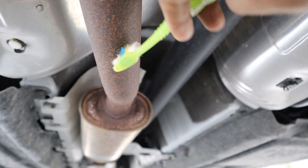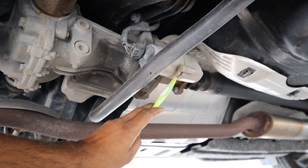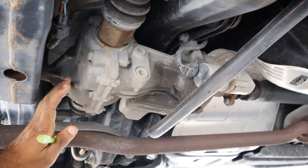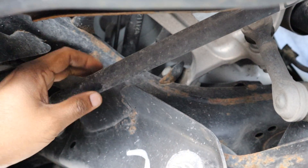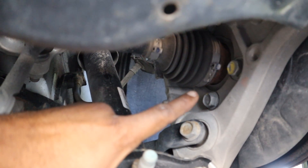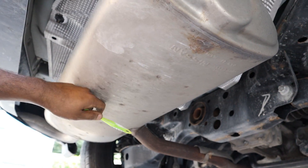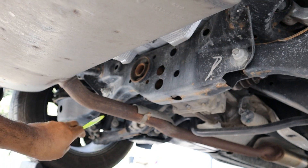Taking a look from the back of the Nissan Rogue, you can see the exhaust and the drive shaft coming back to the rear differential. The rear differential has an electric motor that will activate and deactivate the drive shaft for less drivetrain losses. I don't like how low it sits with exposed wiring — you could easily damage it. The rear differential is pretty small and basic, but does have drain and fill ports for service oil. The muffler at the back has a hidden exhaust tip and should be cheap to replace, however there is no flange, meaning you'll have to chop it off and re-weld it, or replace everything back to the resonator where there is a flange.